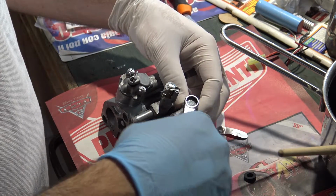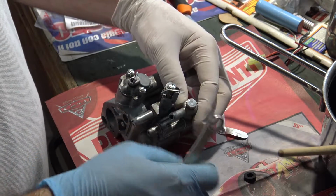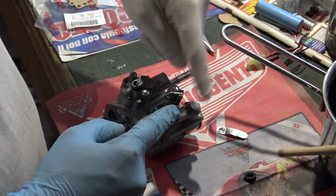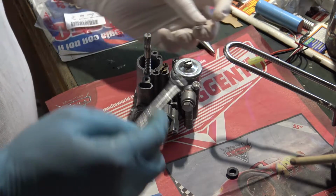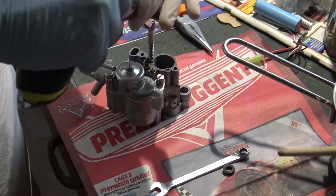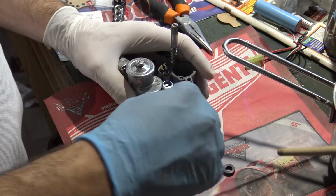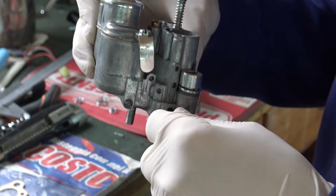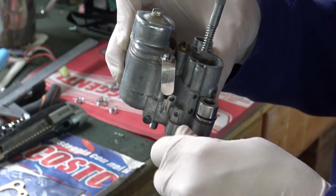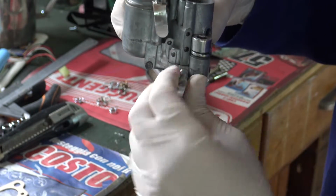I suggest you give the last tightening once you mount this, because here you have to put the fuel hose. You may also consider putting the fuel hose on before connecting this to the carburetor. If you want to maintain the carburetor tags, engage it on one of the screws. Last tighten by hand. This is the air fuel adjusting screw. You must tighten it all the way in, then unscrew it one turn and a half. Any other regulation is done with the engine running.